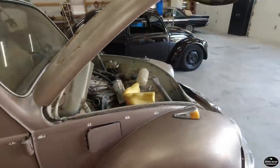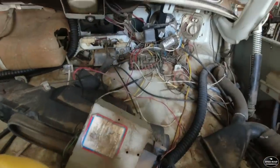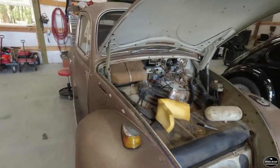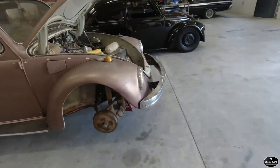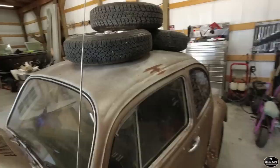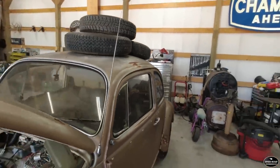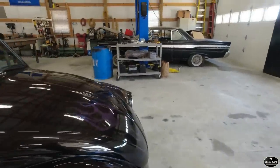I don't know what I'm going to do with that car, but the main reason I needed it was to figure out what was what on the wiring, since this one doesn't appear to be modified. Volkswagen apparently didn't loom anything up or really organize anything — they were kind of just about efficiently building cars. But it also had good tires on it, so I've got the wheels and tires from that car on the front of the black bug right now. I've got matching wheels that still need tires — they're 145/15s and I can't find those anywhere, so I think we'll have to step up to 165s.